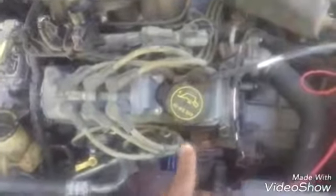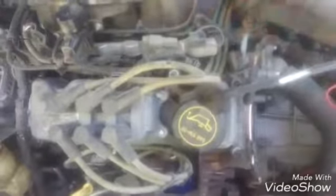Basically I just had air compressed into this cylinder that kept the valve up. I was able to use a spring compressor to remove the broken valve spring and put the new one on, then put the retainers, the locks, the rockers, and push rods back in. No damage done, but the car threw a light saying something dealing with the left bank of the engine, which is this side here.